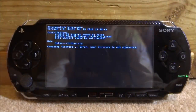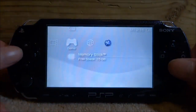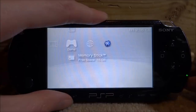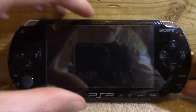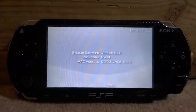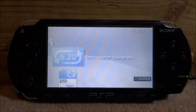The Chrono Switch Downgrader should let you downgrade your firmware. For me it's saying firmware error — I think this is because my firmware isn't actually permanent; I must have just run the PRO update temporarily. To check this, I'll power off the PSP completely, then power it back on and check the settings. After restarting, going to system settings and system information shows just normal 6.20 — so I got lucky. If yours is permanent, just open the Chrono Switch Downgrader and press X to downgrade — it's pretty simple.